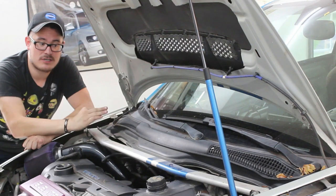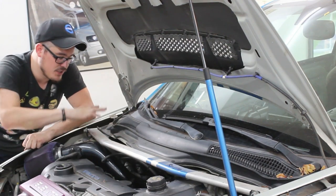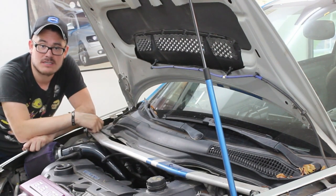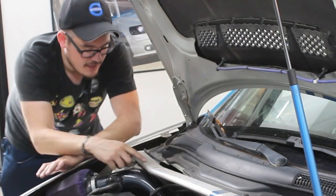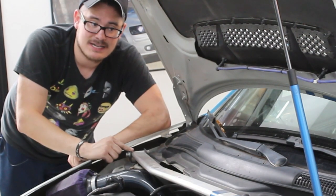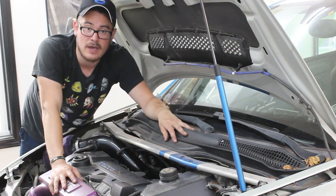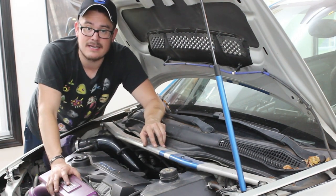If you can get your hands on the Volvo one-inch strut tower bar, I actually would recommend it — it's a nice upgrade. While not the best, it's usually pretty cheap, and there are some pretty cool covers that go over the end. Now, some later model years of P1 Volvos had a half-inch strut tower bar, and that really was nothing more than cosmetic — you could actually grab that bar and flex it by hand. One of the reasons why I like the Euro Sport Tuning strut tower bar is because it has brackets that bolt to the strut towers, and then the bar itself bolts separately to those brackets. This is especially useful if you need to access your brake fluid reservoir, remove your battery, or even try to jump-start a car, since these strut tower bars can sometimes be in the way. Another great thing about the Euro Sport Tuning bar is its relatively flat design, so it should clear most aftermarket intake pipe options.